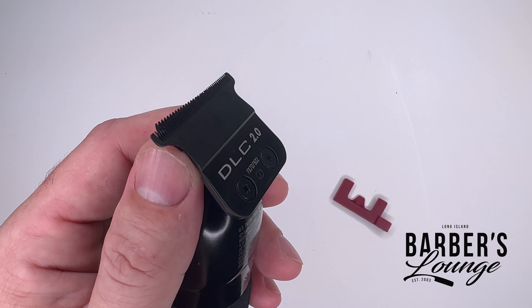You'll see you can push the cutting blade above the stationary blade — that's exactly what you do not want, because that will chew the customer up. To help get a good setting, this is what the burgundy piece is for. The tab goes to the back of the blade and you slide it up there, which pushes it straight. If you don't want to eyeball it, you can use a table — press the teeth down on the table and give it a rocking motion to the back until the body of the clipper stops you. Once that's done you should have a nice zero gap.